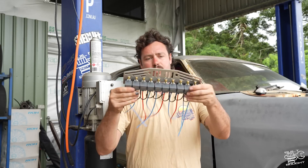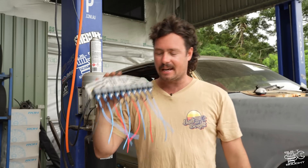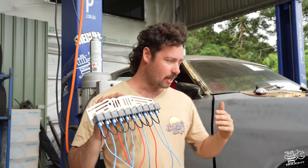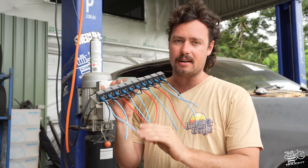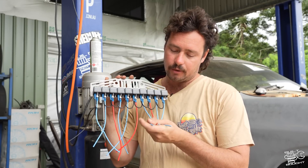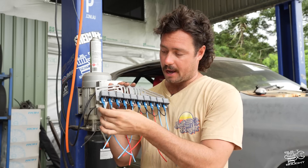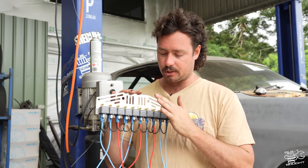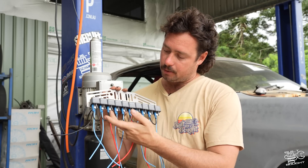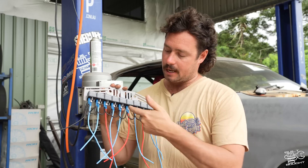Here is our little relay mount. It's a shame the flexi that I laser cut in there is covered up by the actual relays, but I've gone for 10 - there are only six switches on that panel but like I said, always have a few extras. I've actually run an extra wire to every corner of the car in case I think of something later. Once everything's loomed up it just looks like a bird's nest. I'm going to run all these power cables through a fuse box from a fat cable from the battery. All the earths here are just a trigger wire earth so they can all be linked - it's just telling the coil in the relay whether to open or close.